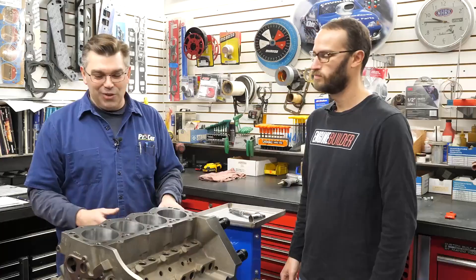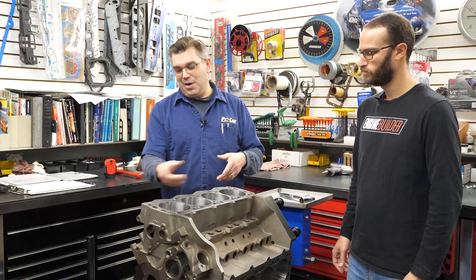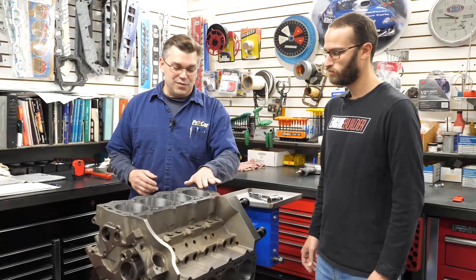First, we got to get the block clean. We do need to paint this block because it's not like the old blocks where everything was cast iron — cast iron heads, cast iron intake — and you just paint the whole thing. This is mostly aluminum except for the block. So we've got to paint the block separately. It's a little tedious because we want to plug all the holes, tape off what we don't want painted and the machine surfaces, and then just spray it. We'll probably do Ford Blue to keep with tradition. As Chris mentioned, we've got a decent amount of work to get through today, so stay tuned — Chris is going to be showing you how he's getting this block prepared for assembly.